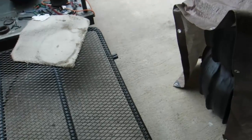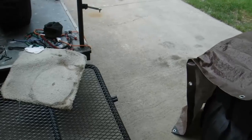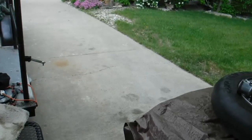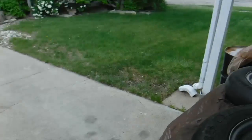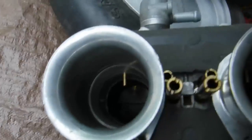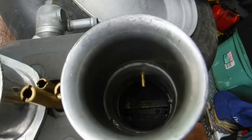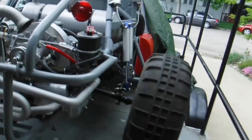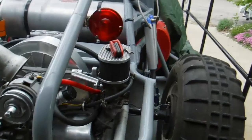This thing was probably flaming — this is a cotton filter, so of course that's going to catch fire and break down; it's oil-impregnated. Another thing I noticed on this car: this is the carburetor that had the fire in it. There's a lot of charred stuff on that butterfly — it should be brassy-looking. He told me he soaked and cleaned them twice, and the car just never ran right since then.